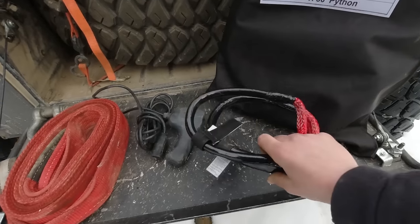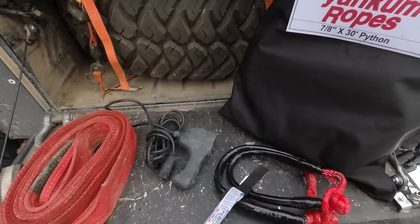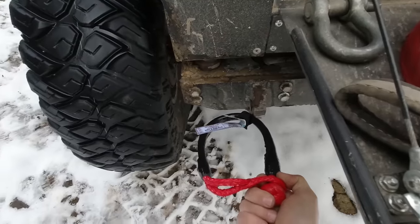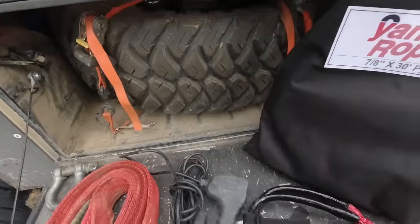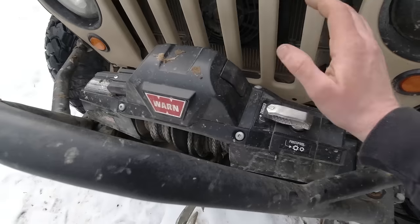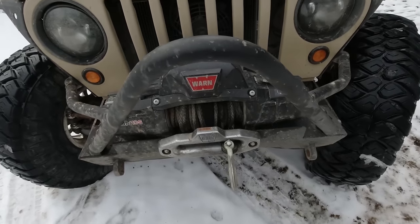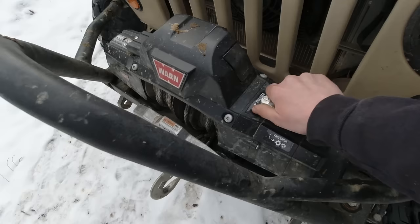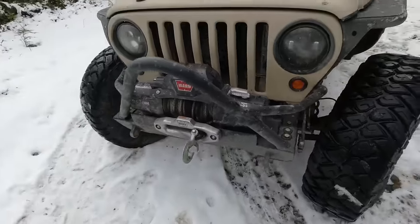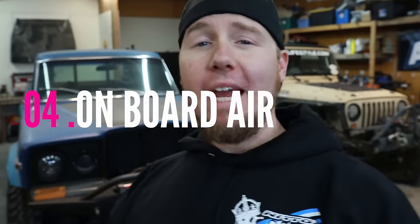These are soft shackles — something that's kind of new on the market and pretty sweet. They're really lightweight and rubber-coated so you can't rip them. It's a really easy way to connect if you want to pull somebody by their frame, axle, or link — you just wrap it around and it gives you a nice recovery point. You also can't talk about recovery equipment without talking about testing it. Don't just let your winch sit on your front bumper for years without checking if it'll work. Every few months, hook your controller up and make sure it works.